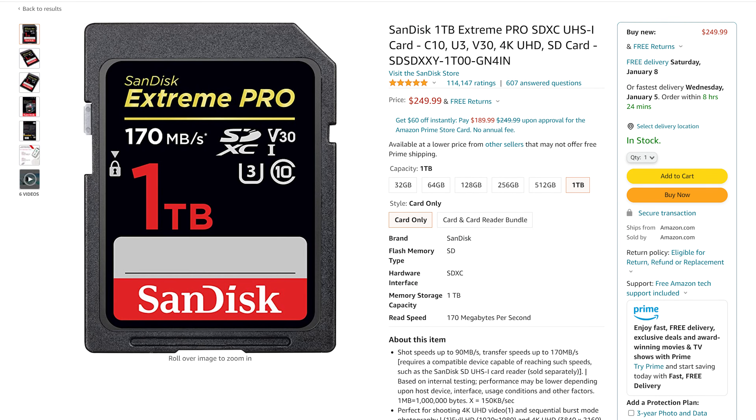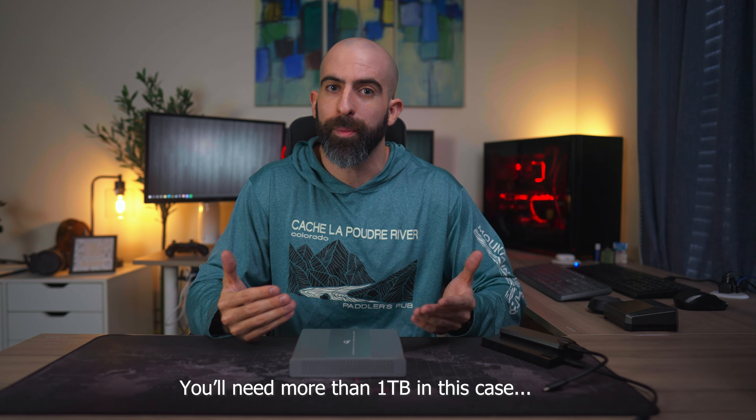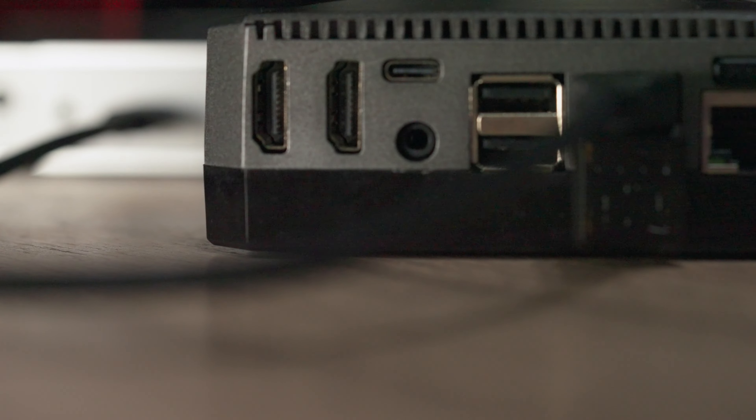But you still have your originals, you say. Well, unless you have extremely high-capacity SD cards that can last for days or weeks of shooting, you're going to have to clear those off so you can keep using them. Look, I know there are multiple solutions for keeping your data safe, but this makes it simple — just throw two high-capacity SSDs or hard disks in there and just like that you have a RAID 1 configuration set up and ready to go. The second use case is a solid solution for a small backup system in your home lab, where the MEP-DM allows you to create a RAID 0 or RAID 1 configuration in a pretty much plug-and-play experience, including using it on a Raspberry Pi OpenMediaVault NAS.